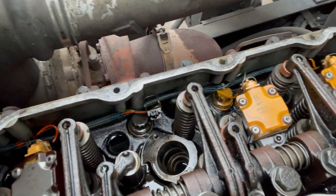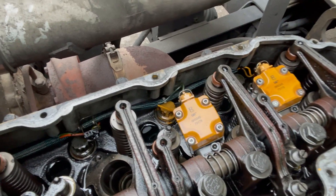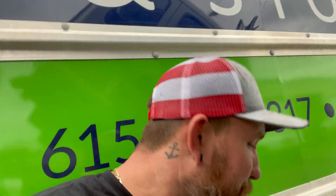If you look, here are your two hold-down bolts and the hose clamp. Now look down into that hole — you'll see it's full of fuel. This is the important thing I want to touch on: you need to get that fuel out of there. This is not a common rail engine; there are no injector lines. The fuel actually flows through the head — this is a HEUI pump system. If you put the injector back in with fuel in there, it will hydrolock the engine and it will not start. You'll end up breaking something.